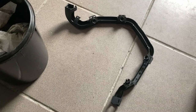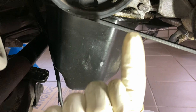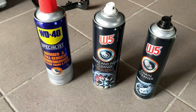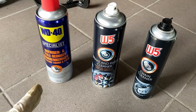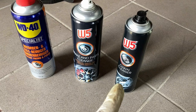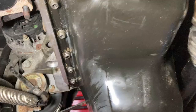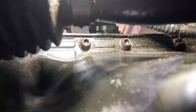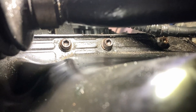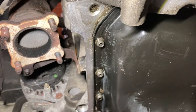This fella — I have to clean it all. Now it's looking rather good but it took me half an hour — a lot of grease, a lot of debris, a lot of sand. Now the plan is to clean the surroundings of the oil sump below and above and try to remove it once and for all to see what's in there. For cleaning I've been testing three products: WD-40, a brake cleaner which works very well, and a chain cleaner — I think it has a little gasoline inside. It works extremely well and is very cheap. Overall those two are the way to go.